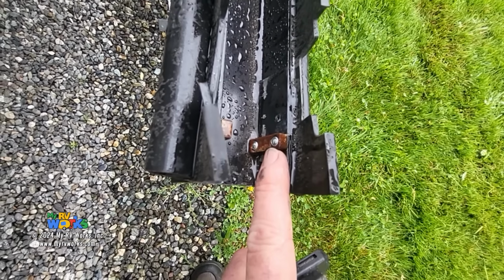So when your bearing block is in, here's your straw. You're going to hit right on top of the roller. It's going to wick itself down on both sides of the roller into the gib. And then you're going to reach back. You're going to feel the top of your drive shaft. You're going to squirt some on the drive shaft. Let it work its way all the way down to the bottom. And this is the only other part I want you to lubricate, right in that track right there where the shoe rides.